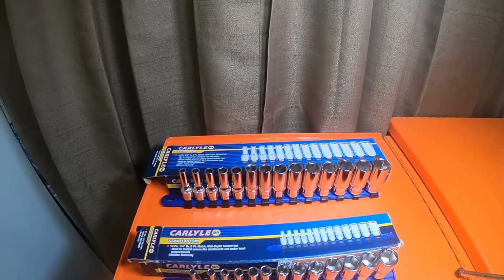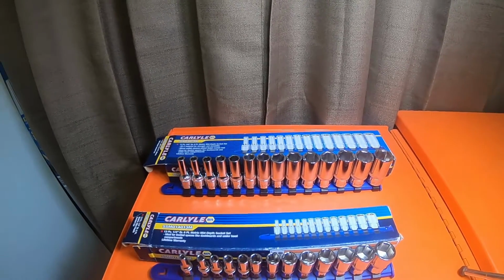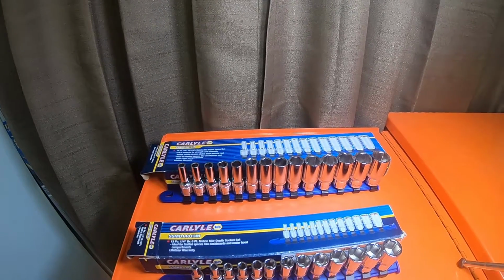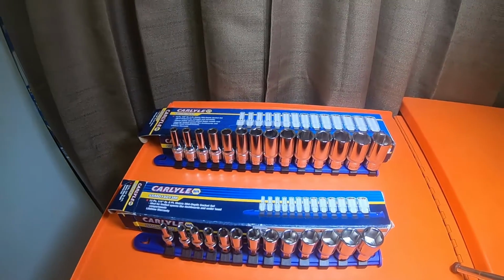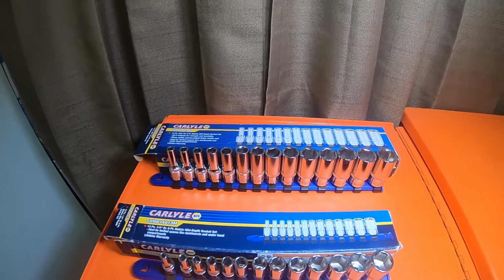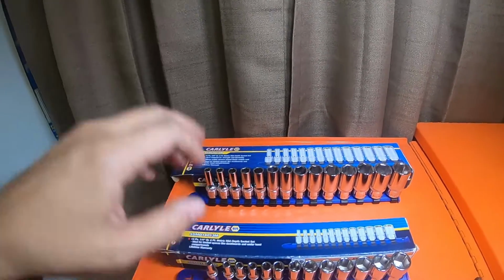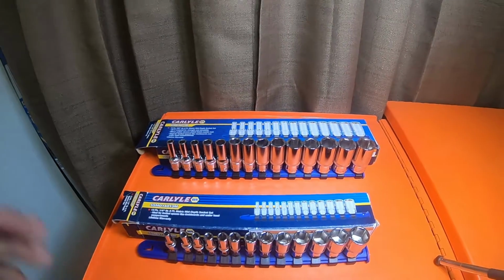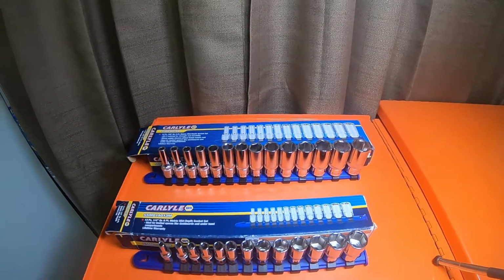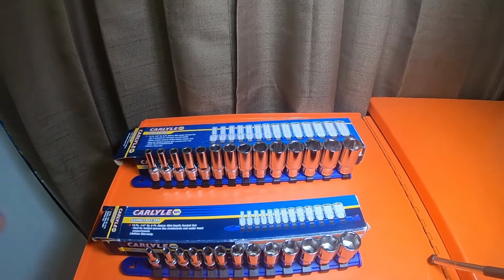It's an older vehicle that's got a 3 belt, you know, the fan belt, the alternator belt, and power steering belt. And those style systems don't have a single place where you just put the ratchet in and tension. Only serpentine systems have that. But these will come in handy for getting in spaces like that, where a deep is just too long and a shallow is just too short.